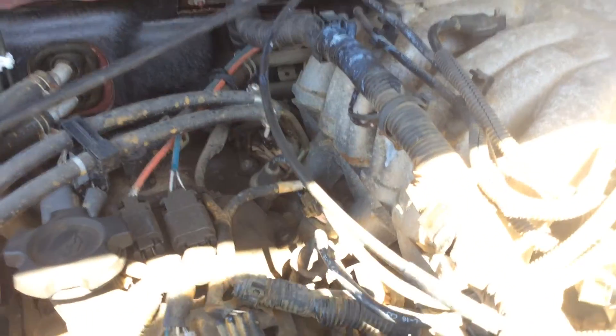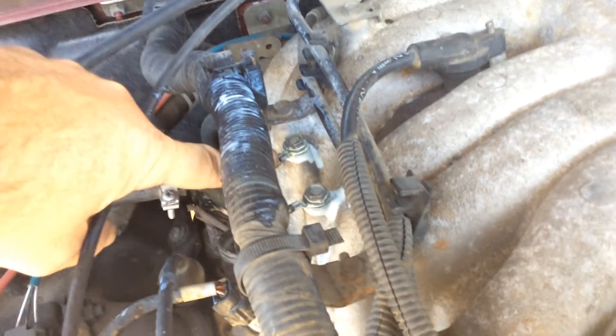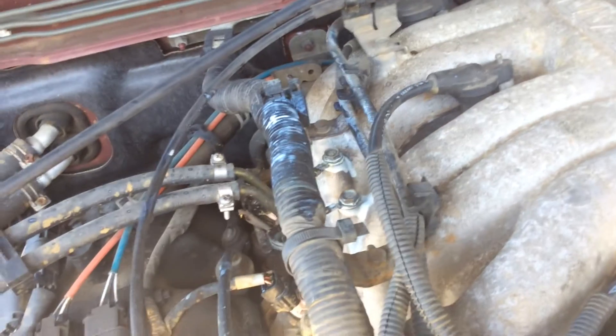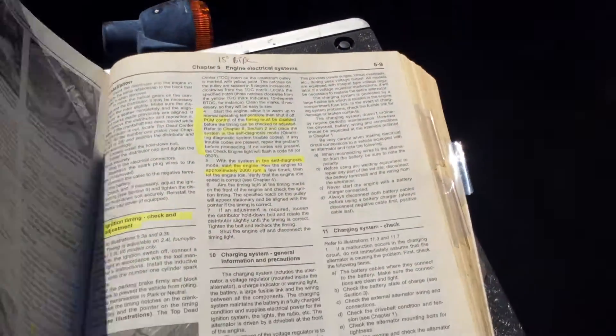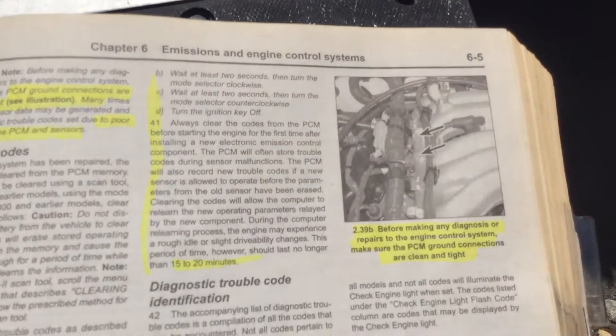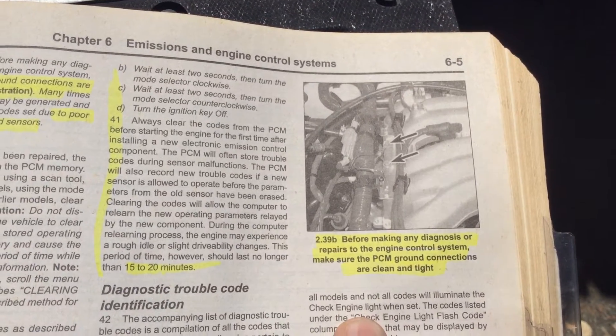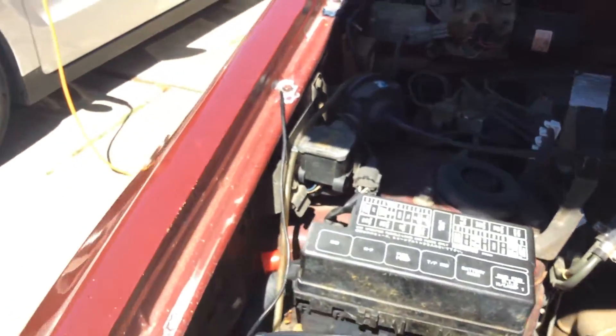The only other thing I did: your PCM under the engine on the intake has ground connectors right there. The manual also says to make sure the electrical ground connections on those are good before doing any work on the computer system. It says on page 6-5 of the Haynes manual: 'Just before making any diagnosis or repairs to the engine control module, make sure that the PCM ground connections are clean and tight.' Mine were pretty corroded, and I know I've always had ground problems on this vehicle.